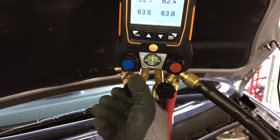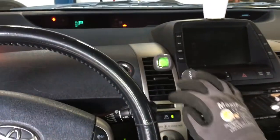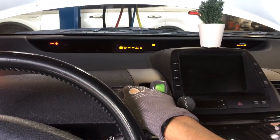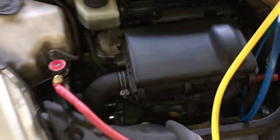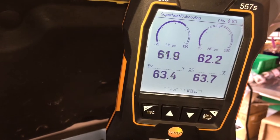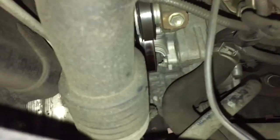That's one of the sounds that a Prius compressor can make when it's bad. We'll cycle it back on and go out there and see if we can catch it. I just heard one as I was walking up — the fan cycled. Watch it again — listen, there it goes. Nothing. So that was the attempt of the compressor to engage.